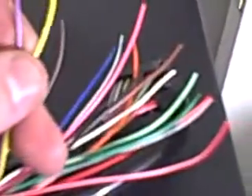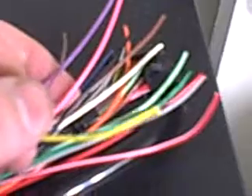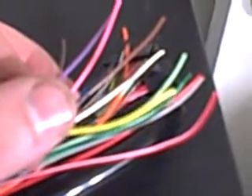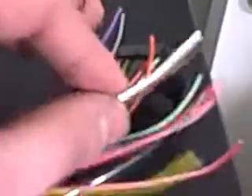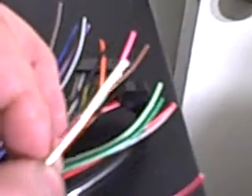After that you have the yellow wire. The yellow wire is the airflow output — the MAP or MAF sensor, whatever it's called in your car. This is output one and it goes to the ECU. Then after that you have the white wire. The white is the MAP or MAF input. This one goes from the sensor into the harness or into the unit.